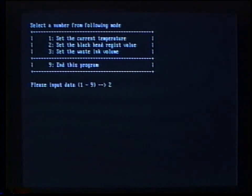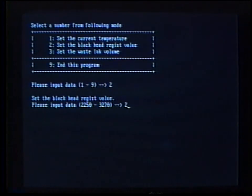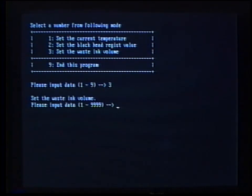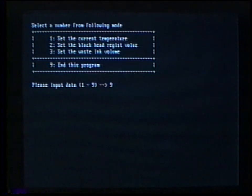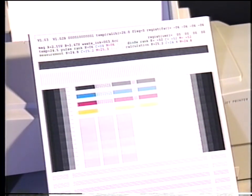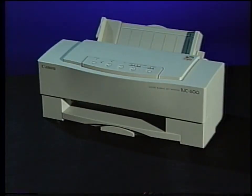From the main menu, select 2 to enter the black ink resistance value and then press enter. This is the value we measured on the printhead. Enter the resistance value — for example, if the value is 271.2 ohms, type 2712 then press enter. Select number 3 and press enter to set the waste ink volume. This information can be found on the service test print sheet — if the volume is 35.1, then type 351 and press enter. To exit the program, select number 9 and then press enter. Press the power button on the printer — this will save the data to the printer's double EEPROM. Print the test print sample to confirm your information. Now read part 4 in the service manual and answer the quiz questions in the workbook. This tape will continue with troubleshooting of the printer. Now stop the tape.